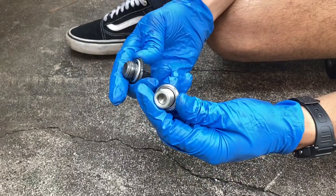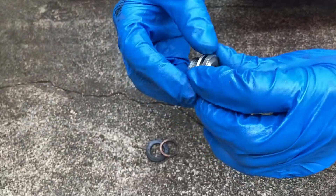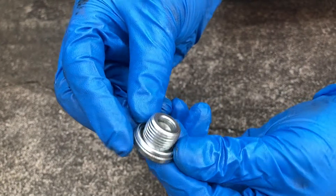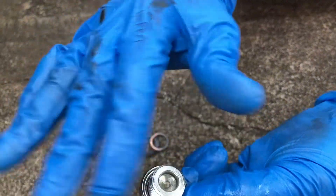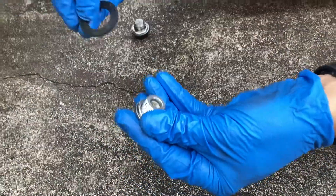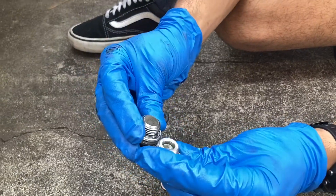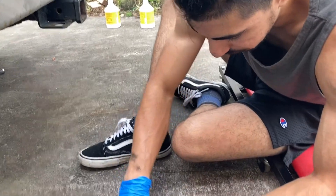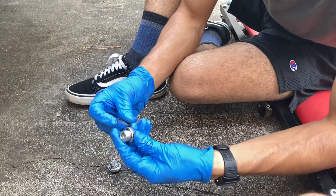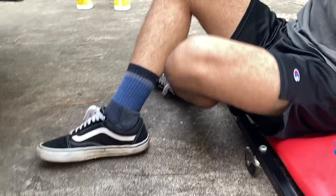We got both washers out and they look a little different than the replacement ones I got. I matched up the part numbers and everything. Essentially, the idea of a crush washer is that as it tightens up against it, it'll crush and flatten out, and that's going to create the seal. We're going to go ahead and put them in and hopefully they do the job well. This was the correct part number, so these were either maybe installed ones. Factory OEM stuff is always going to be a little different from 30 years ago.